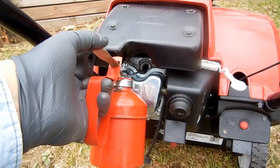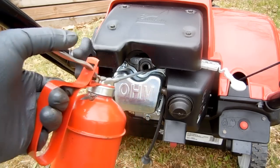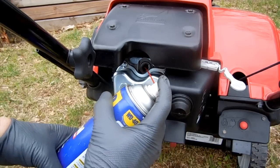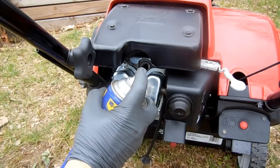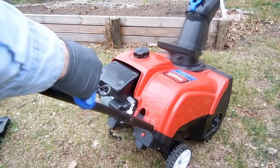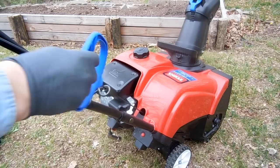The manual recommends motor oil for the treating of the combustion chamber. Squirt 2 teaspoons through the spark plug hole and you're set. Me, I personally use WD-40. Then spread the oil around by pulling on the starter string.